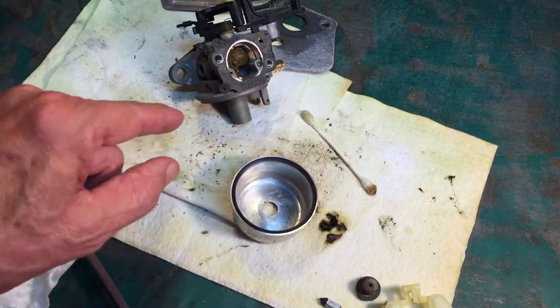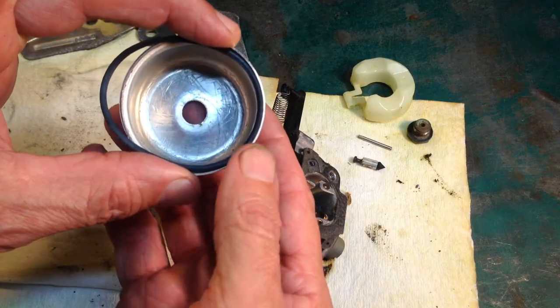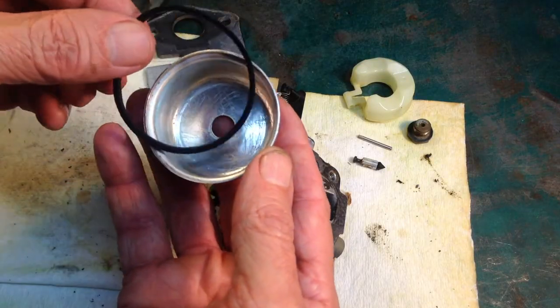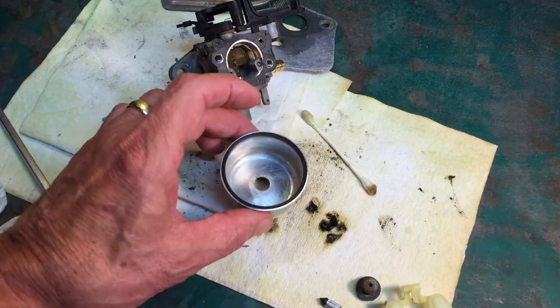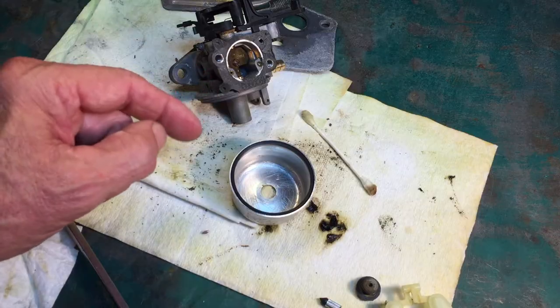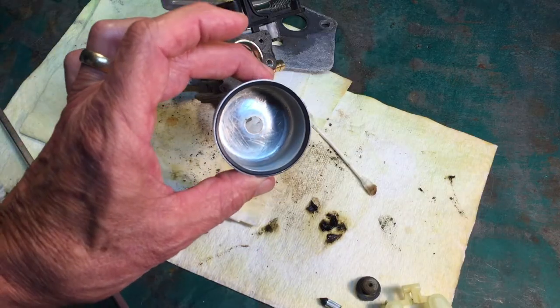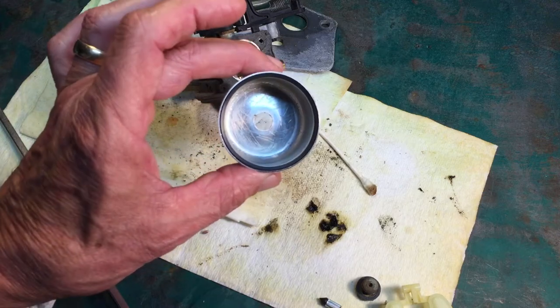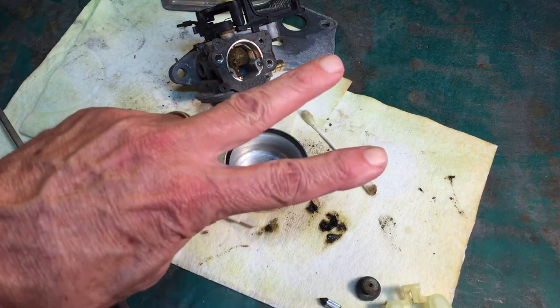Let me find a clip of how it was before and now after. The combination of 10 minutes of boiling water and 10 minutes in the oven — I would say use 350 and flip it every couple of minutes. That shrunk this carb bowl gasket and I can use it again. Never would have believed it, but it worked. Hope this helps. Thanks for watching.